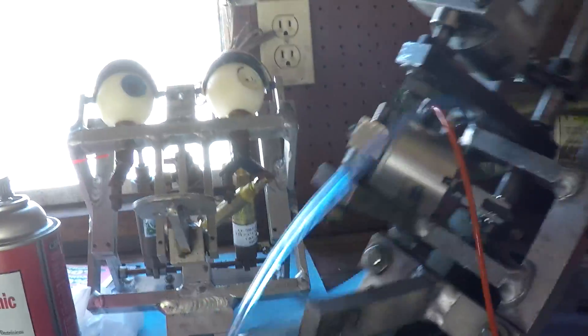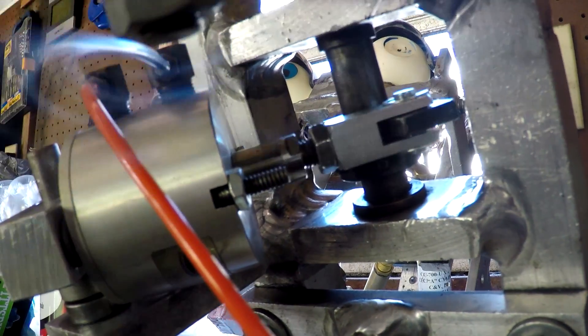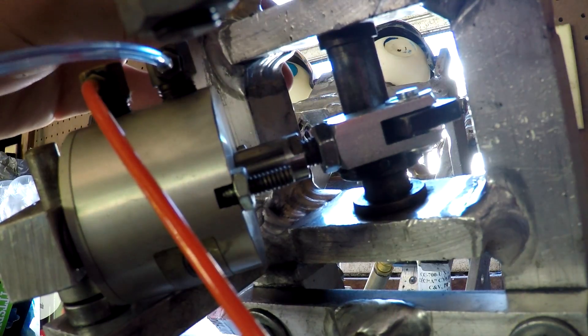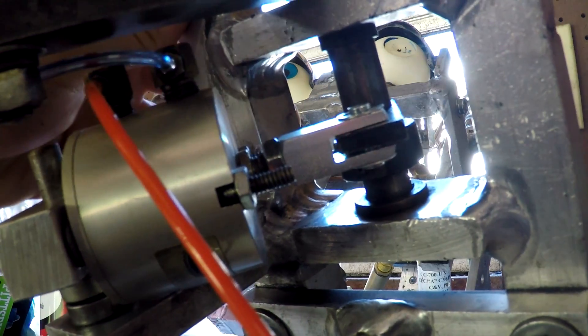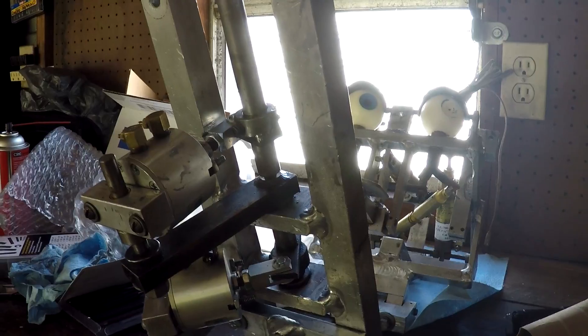I have one hooked up — no leaks. I'm having a sticky solenoid valve again, but there we go — no leaks that way either. Notice the mechanism isn't hitting the side structure like it was before. It's actually stopping properly. You want all your stops to be on the end of the stroke of the actuators. All the actuators tested fine.